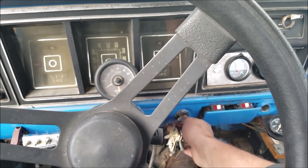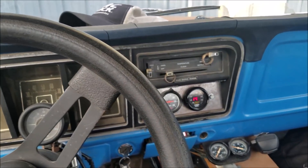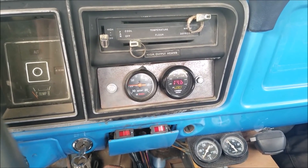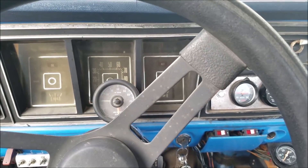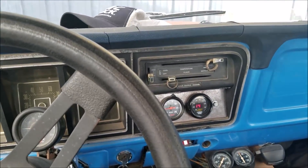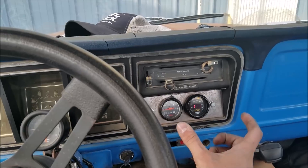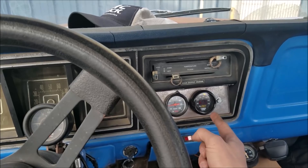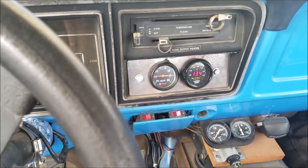I'm going to give it a couple pumps. I don't have a choke on this rig. You can see starting out we're really good and lean — 14.5, 14.6 — and if I let my foot off the gas it's going to kill itself since we don't have a choke. It's going to warm up pretty quick; I've left the heat crossover on the intake still, so it's going to heat that intake up at a fairly rapid pace and our air fuel ratio is going to slowly get richer.